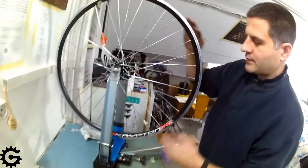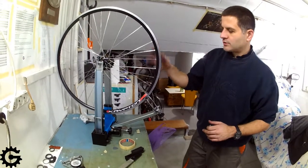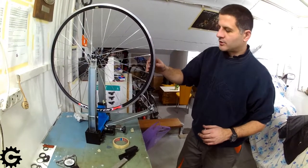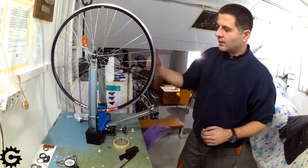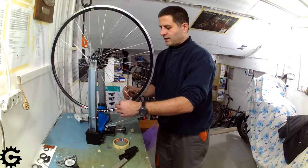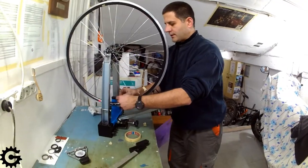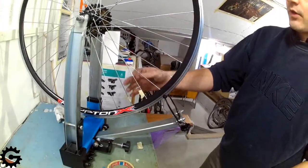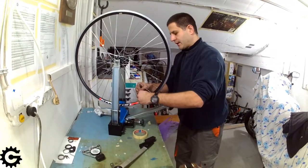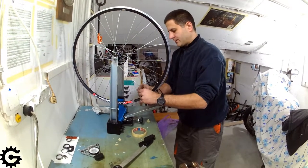This will give me an overview of the tensions on the wheel, and if a lot of spokes have the wrong tension, it is often easier to just unscrew all the nipples almost all the way out and start tensioning the wheel again. Doing this will also give us information about the state of the rim. Does it have any sharp bends or dents or any problems that can hardly be compensated by truing? But if only a few spokes have poor tension, then it can be just touched up and the wheel can be trued and fixed.